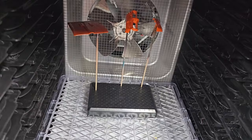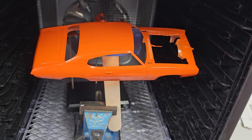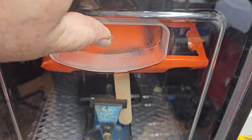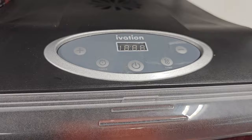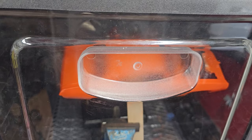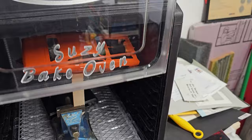We're going to let this sit in here overnight. I don't want to turn that fan on if it's just a little tacky — don't want to draw any dust in the room. We're just going to leave it in here because it's getting late as usual. Next couple of days we'll start baking it. Once I turn this on, we'll cook it at about 122 degrees for about 10 to 20 hours. After about 20 hours of cook time, she's hard as a rock and ready for wet sanding.